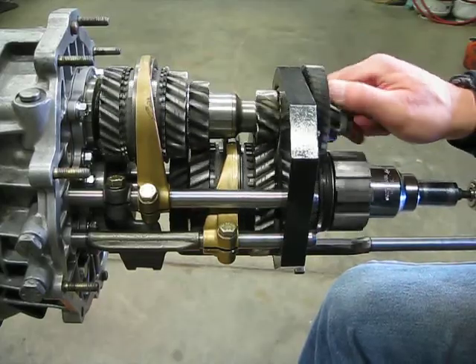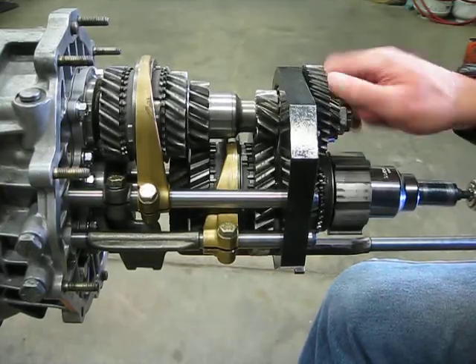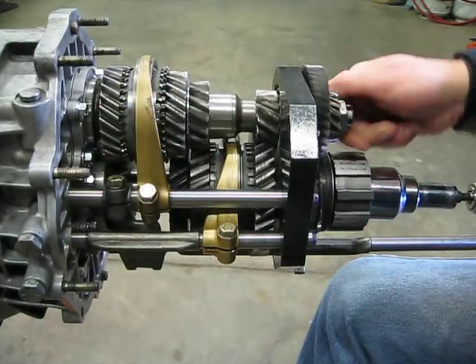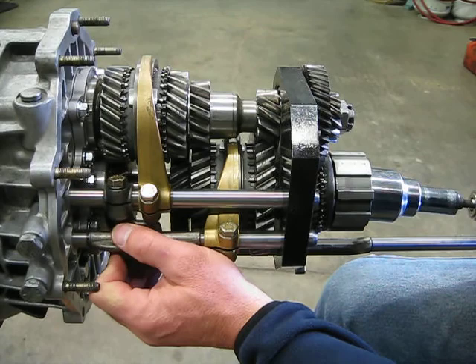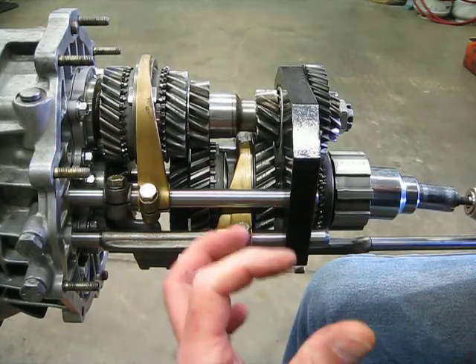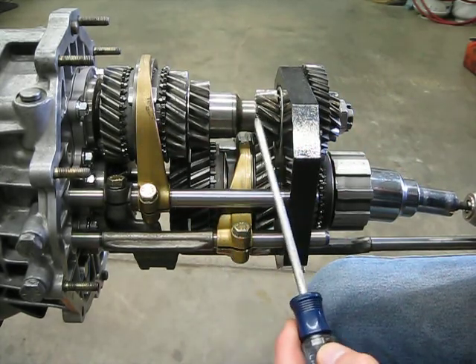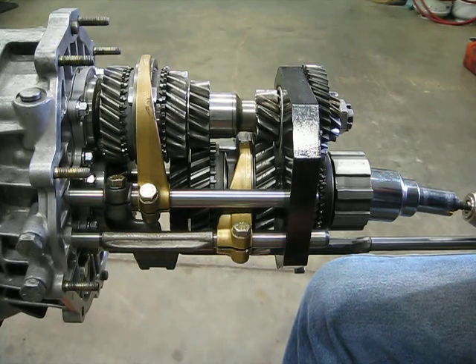So as the output shaft is rotating, with the clutch out, you're spinning up the input shaft to try to get it to rotate at the same speed as the output shaft. Then you push the clutch in again, and the input shaft, based on the RPM you gave it, will continue to spin, allowing the shift sleeve to engage onto first gear at the same RPM. You're matching the input RPM of the engine to match the output going through the pinion shaft and out to your wheels. So that's an attempt at showing what's occurring as you're double clutching.